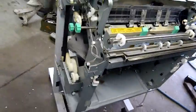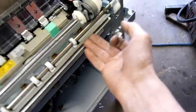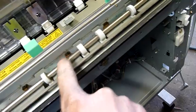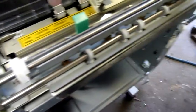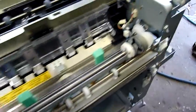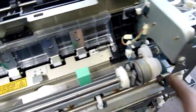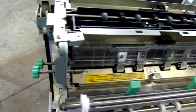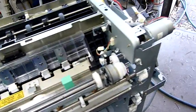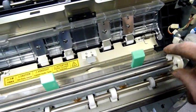Now that we're down to bare chassis, you can see paper from the copier comes in through here. These little sleeved pins are the hole punch — that's the first thing that happens. Paper feeds up to a point, gets punched, and then goes through to the other finishing side. It'll get stacked together and stapled if necessary, but generally if it's just hole punched it'll get assembled in a binder anyway, so stapling's not necessary.